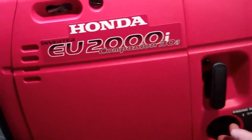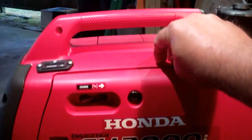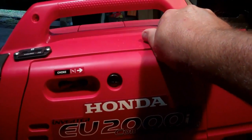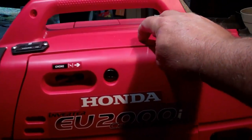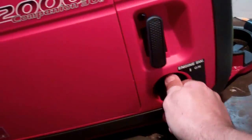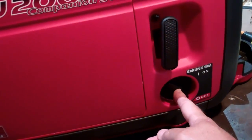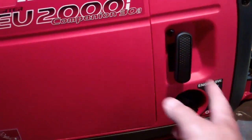A lot of people — you may have seen videos on YouTube — will put a valve up at the top where you can turn the valve off and let the carburetor run out of gas. But there's really no reason to put a valve up there, because when you think about it, this down here is already a valve. When you turn it to off, it turns the valve inside — a quarter-turn valve — which shuts the gasoline off. The only problem is there's also a switch on it, and that kills the engine immediately, so it never runs out of gas.